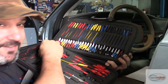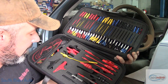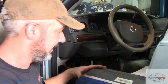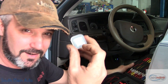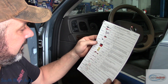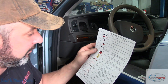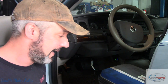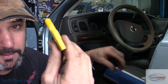I want to show another aspect of this kit that we don't use that often - at least I don't, because I'm not in the body shop business - and that is the airbag simulators. Nothing super fancy. It comes with a little box of resistors. These resistors are unique in that they're the ohmage we need for a lot of airbag systems. They come in a 2.2 and a 2.7 ohm resistor in the little package, and then it also comes with a little dongle to put them in.